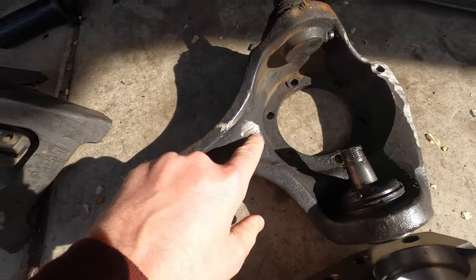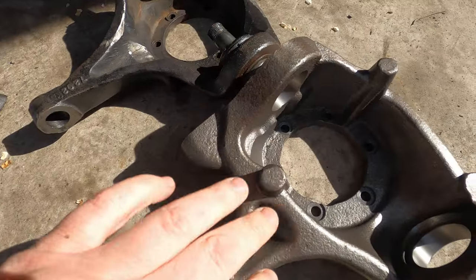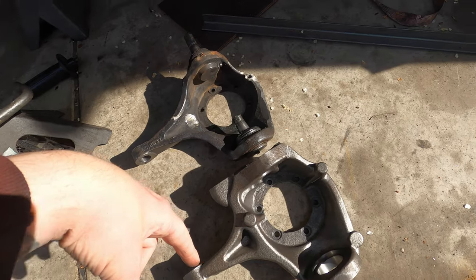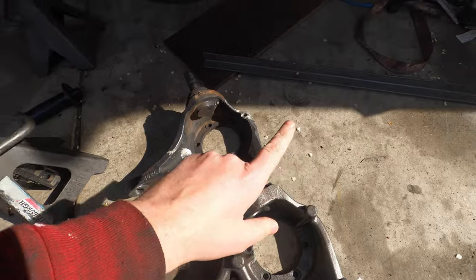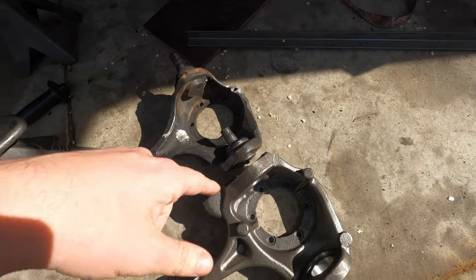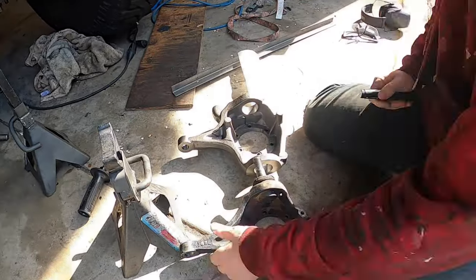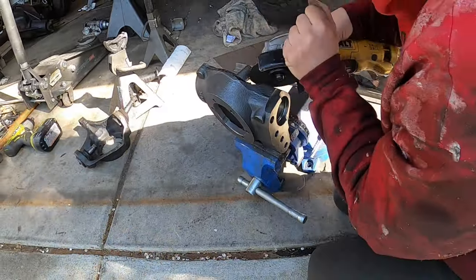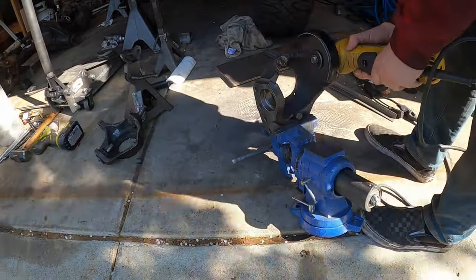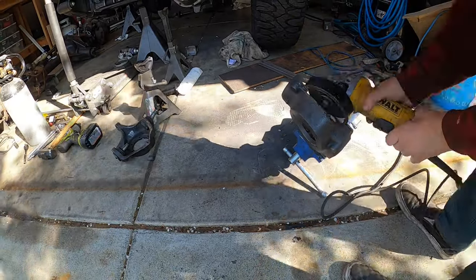That's all going to have to get cut off. Right here is the most critical part — getting the RCV bell inside the axle required taking a lot of material off there. This is completely filled in, so this is going to be a lot of grinding to get this knuckle to fit. My only real concern outside of that is that we have no axle stop, so I might have to weld a nut onto the tube instead, because we need that to make sure our tires aren't turning too sharp — they will hit the leaf springs. As I'm taking off all this extra material, the thought is definitely going through my head: is this too much to take off? When you go to upgrade these knuckles, it's kind of intuitive that you'd have a stronger axle, but this is definitely making it weaker. Really, there's no way to do this other than chop it off, or you can't use the RCV axles.